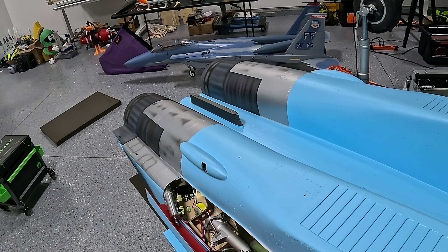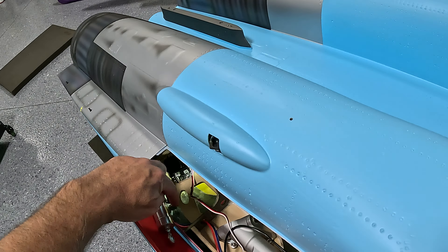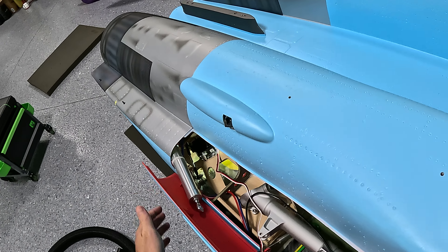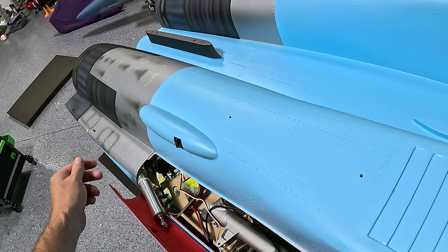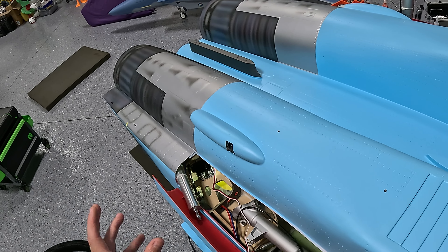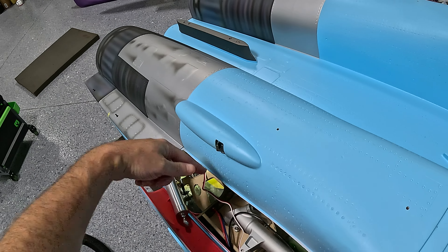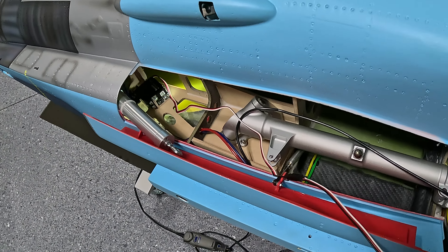The first day was just a lot of fitting. I had to trim some area here so that the arm that connects to the steel rod doesn't hit because of the screw. If you use the clevises, it's not going to be an issue. But because I changed to the ball link setup, I had to do just a little bit — nothing crazy. Really it was just cleaning up in there, because they had like a little notch kind of cut out. Essentially if you just made it flush, it was no big deal.